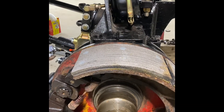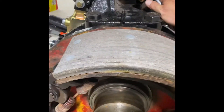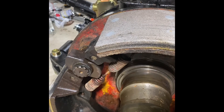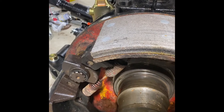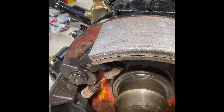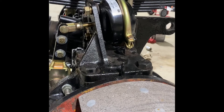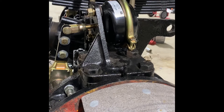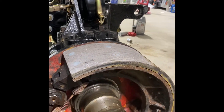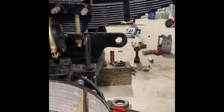Just give you a quick example of that — most of these parts were already on the truck, I haven't changed any of that. Put a little air on the actuator, you can see the s-cam turns, and then when the air releases you can fine-tune it on that slack adjuster. I did order a new E7 Bendix brake controller for inside the cab and we'll be running half-inch lines to the back to actuate these brakes.